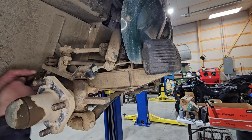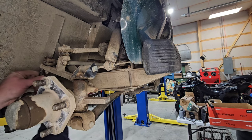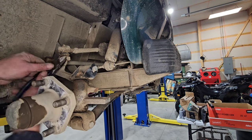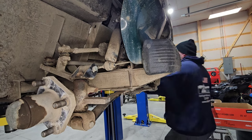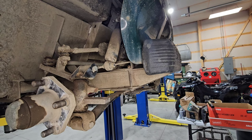The next side has cotter pins, but it also has the steering rack attached to it, which we may want to pay a little bit of attention to. But honestly, once it's on the ground, we can set our wheel and get the steering straight — I'll show you how I do that.